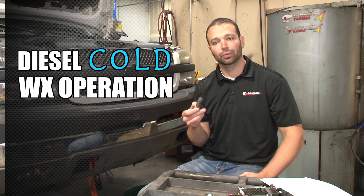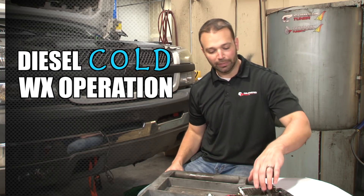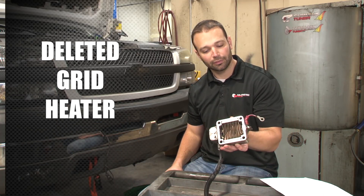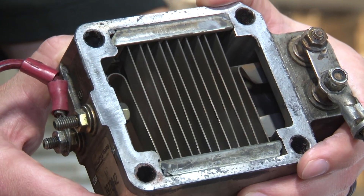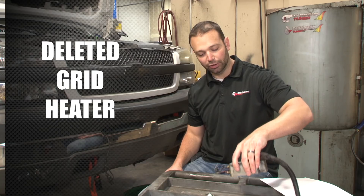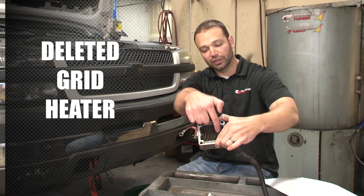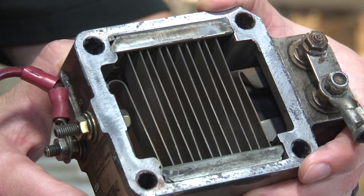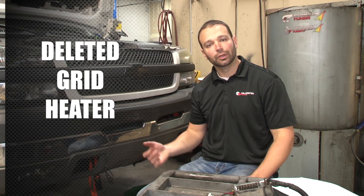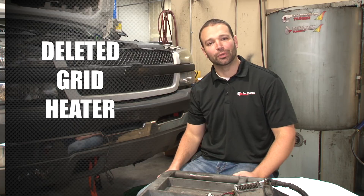Less white smoke, less fuel, less time to get up to operating temperature and have the truck running right. On a Cummins, we see grid heater deletes. Cummins don't have glow plugs — they have grid heaters that go between the intake horn and the plenum. This thing draws a lot of amperage and really does the job well. When you're turning your key to run and waiting to start, it's because this grid is getting cherry red and getting hot air into the engine. We see those deleted again on account of improving airflow, but trucks don't start very well when it's cold, so you don't get to take advantage of your extra horsepower when your truck's parked.